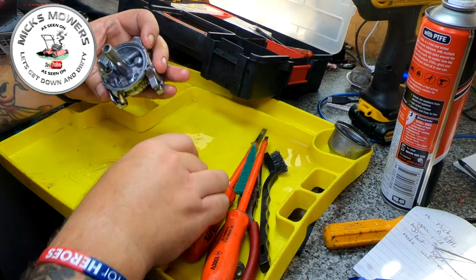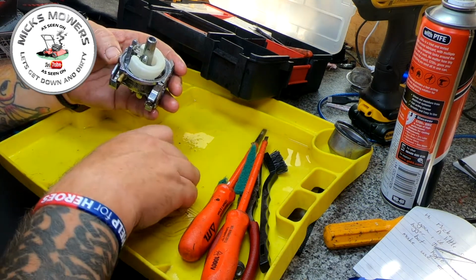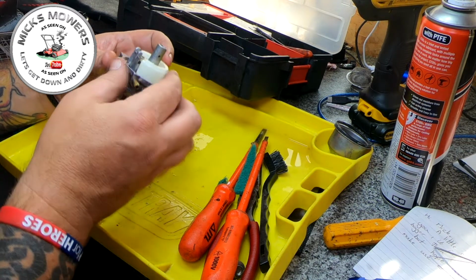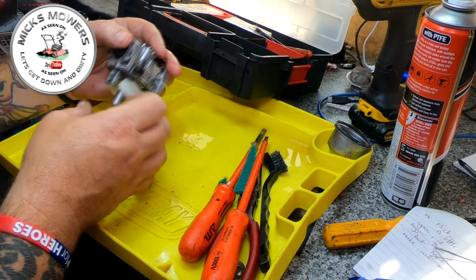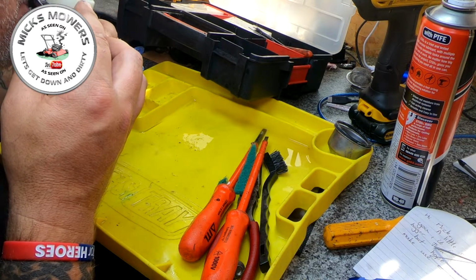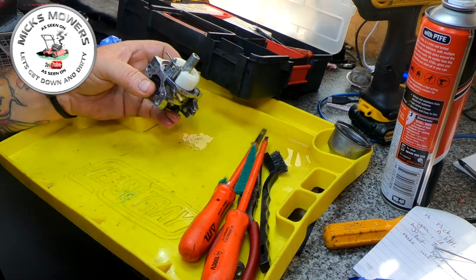Right, so I've had a real good clean now, best I can, and that's about the best I'm going to get it. I mean, it was stuck beforehand, and it now seems to be working. I'm guessing when the fuel gets underneath it as well, it pushes that needle up. It's actually the float that stops the needle from coming up any further when the fluid hits it. So you see it actually is floating there now. Tip it upside down. So that's shut off. That's flow. Off. Flow. Yeah, that's it. I think we got it.